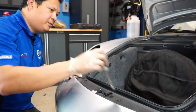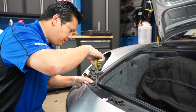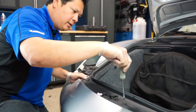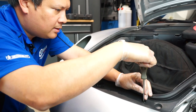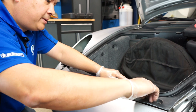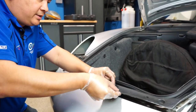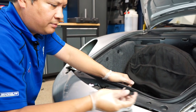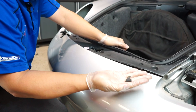Our next step is to remove this plastic trim cover. Simply take a flathead screwdriver, give it a quarter turn and it'll lift up. Do that at each fastener — quarter turn, quarter turn — and everything should come loose. This pops right here; be careful and hold on to these as they tend to fly. As you can see, this car is pretty old, and if you like you can order a new piece so it sits nice and flush, but these falling apart is actually quite common.